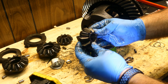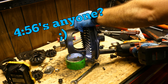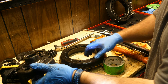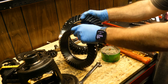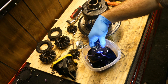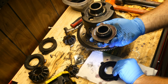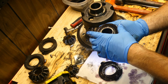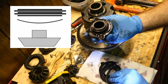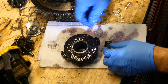At this point I'll be removing the ring gear for replacement — putting 4.56s in it. These bolts are left-hand thread so spin them to the right to loosen. While doing this work it's a good idea to soak your clutches in clean gear oil; this will help them break in easier on the initial drive. They are twist-tied together — leave them tied until time for install. Remove the tie and place them in the exact order on the gear, starting with the convex spring — the concave or bowl side will face the clutch discs. One by one install them in order onto the gear then secure them with the new clips.